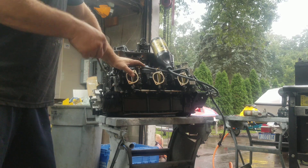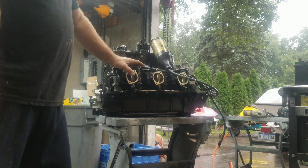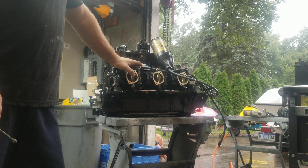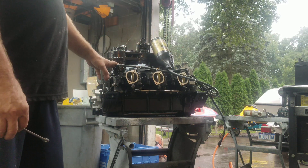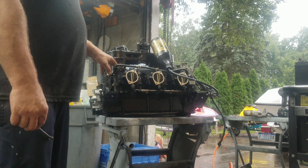So we rebuilt it. Unfortunately when we do an SPT motor we will reuse their cylinders, because we don't interchange the Nicosil with the steel cylinders and we think the steel cylinders are a little bit lower quality. So we prefer the Nicosil.